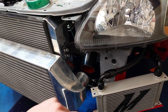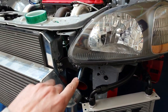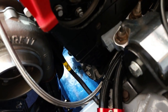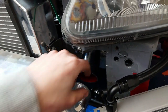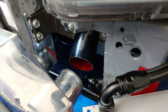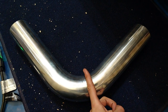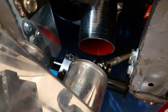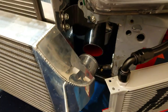Before we go do some more cutting, I might as well get this little piece ready to go. I made this easier by using a three inch to two inch 45 degree coupler here, so you can see where it connects to the turbo and comes out here, so I really only need a small piece. Eyeballing it here, it goes off at an angle but it's not quite 45 degrees, so I'll cut it right here and then just a couple inches down I'll cut it right there as well. I'm guessing that's going to work.